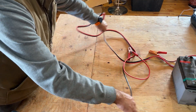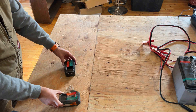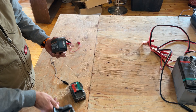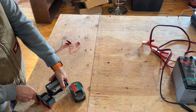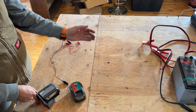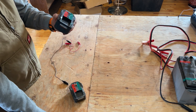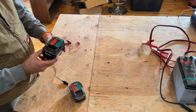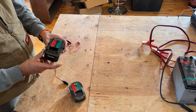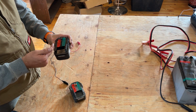Let's assume you've got lithium-ion batteries. Lithium-ion batteries are slightly different. How many times have you taken a lithium-ion battery, thrown it on the charger, and it won't charge — it flashes quickly, won't charge, it's dead. You've tried over and over again and it won't work. Well, chances are, once again, you've left this battery sitting so long that the voltage has dropped so low that the actual charge gate or circuit board in here won't even allow a charge into it.